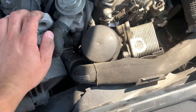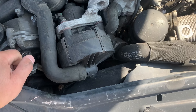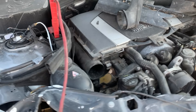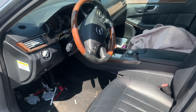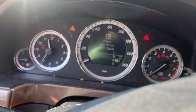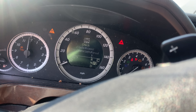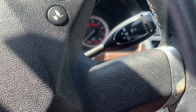I really want to know if this thing will crank first — I don't want to put a cam sensor on an engine that's locked up. Not that this is locked up or anything, but let's try the jump pack, give it the old 12 volts. It's clicking and stuff. The clock is upset, check coolant level — I don't need to do that, I just want to hear it start. It's not doing anything, so that's not a cam sensor problem — that's something else.